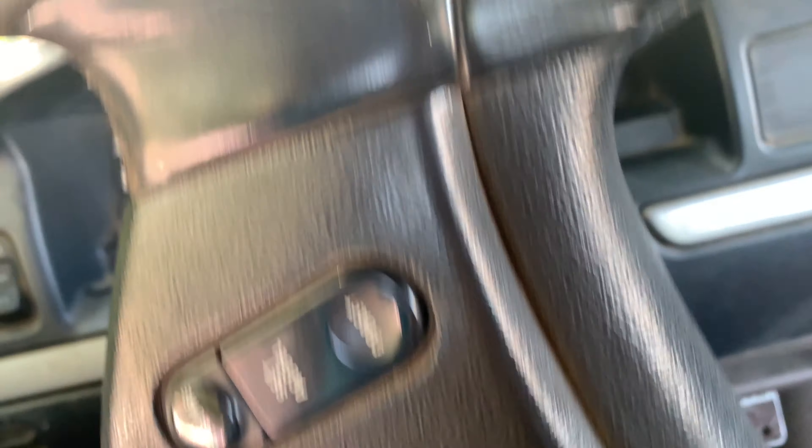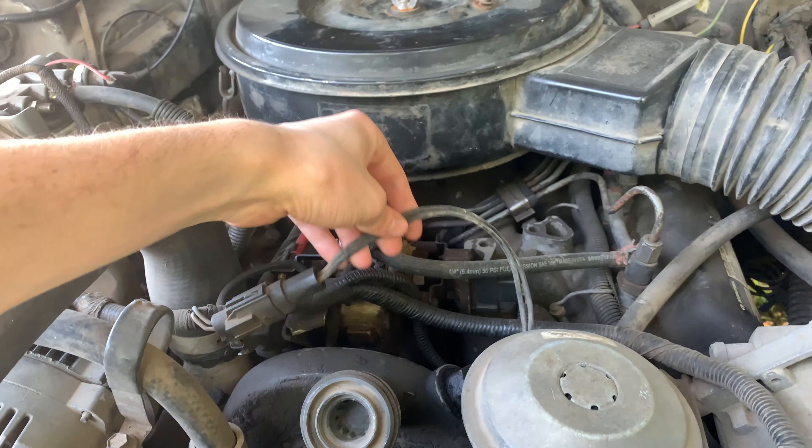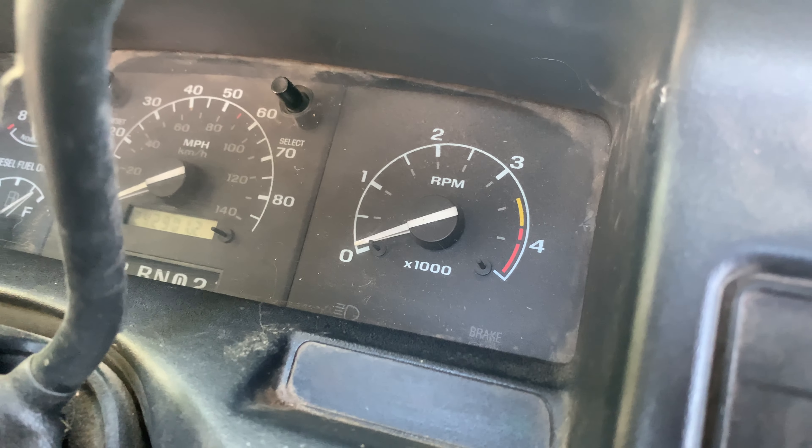I got it to idle down a little more, but I was kind of hoping that tach would come up — I'd show you, but I'd have to go wiggle it out there. I'm gonna go pop it here and wiggle the tach sensor. I just set the idle down a little more; it was idling too fast. This is the sensor right here — kind of wiggle it a little bit. It's like $70 for a new sensor and I don't know if I want to spend that. She still didn't come up — bad short in the wires.